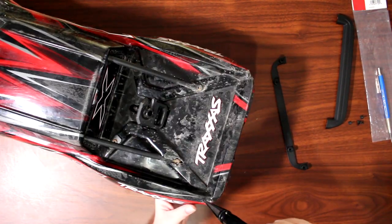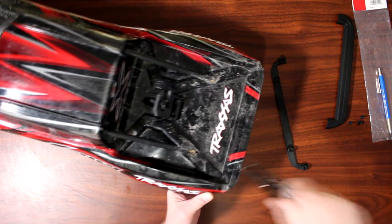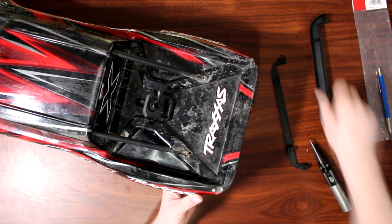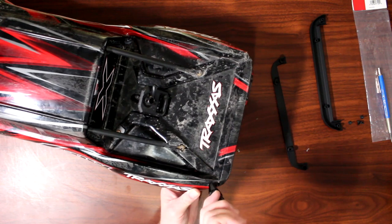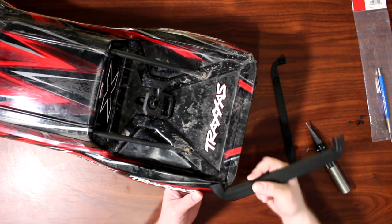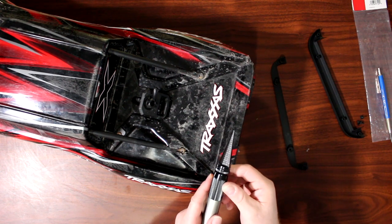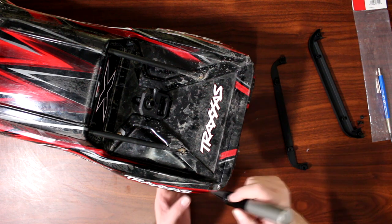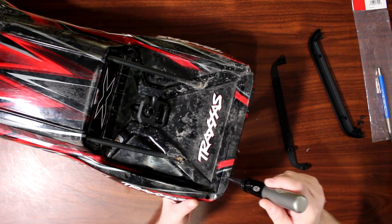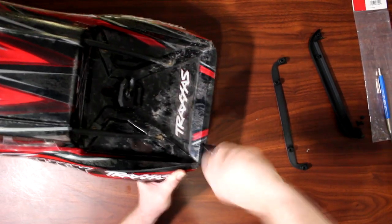Now on this side it's just a little bit easier, and I kind of gauged it to the point where I need to oversize the hole. This holds perfect. On my body reamer — I'm not sure if you can see it — there's a gauge on it. Basically I check seven and a half, and I'm just going to do all four at seven and a half.